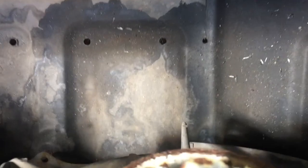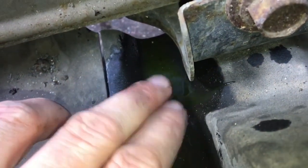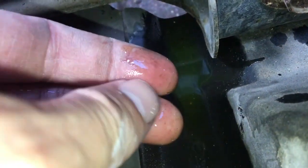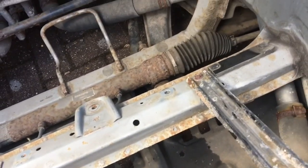When I follow that patch on the drip tray, eventually those old stains turn wet. So I don't have the smoking gun yet. I'm not sure exactly where the leak's coming from, but it's almost certainly some kind of seam on the near side of the radiator.